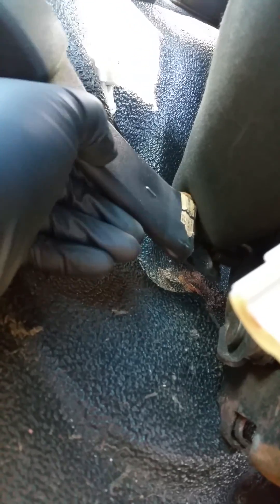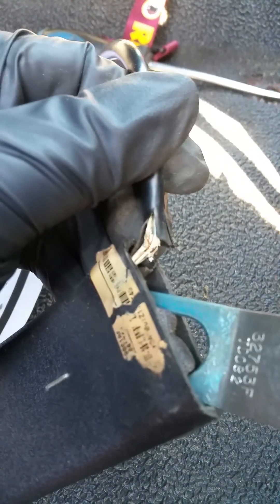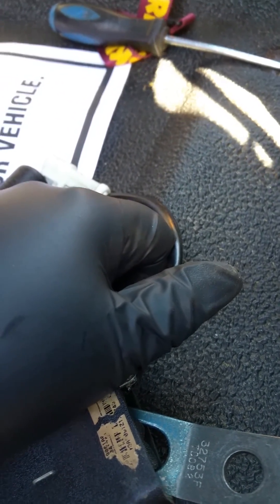There's a little bolt back there — right here, this bolt, it goes up through the seat. This connector plugs into this connector and runs under your seat. Four bolts, easy job. Right now I think I have found my issue. As you can see — I wish the camera would focus — I have a splice wire there. Basically from the seat rocking back and forth, it tore through the boot. Oh man, that just might be my problem right there.